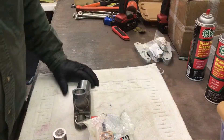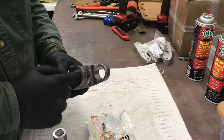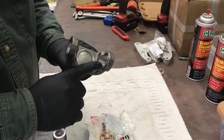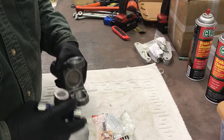Let's get back to the u-joint. This is all brand new Spicer stuff, but if this was a used yoke I would sand or use emery paper to clean up the bores. A lot of times this area right here will get damaged when you're beating out the old u-joint. If you want this smooth, you pretty much want to assemble this with very little force.